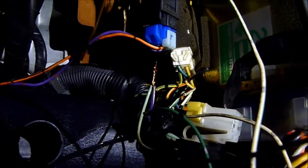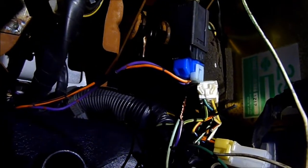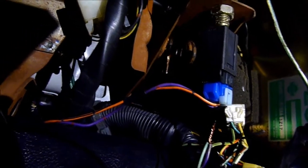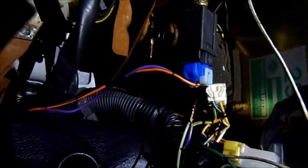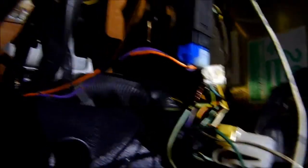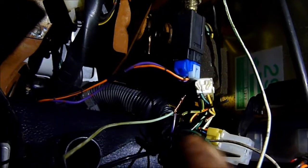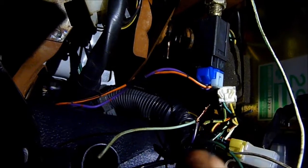As you can see there's a whole bunch of spliced and cut wires from the previous owner. I did some research and found out that this car had a VG30 in it, not a CA — I thought it had a CA20E, but I looked at the firewall and it said VG30E. I looked up the wiring schematics and found that the coolant temp wire for the cluster — not the ECU — is purple with a white stripe, and I found it right here where I'm tugging.